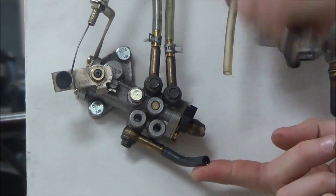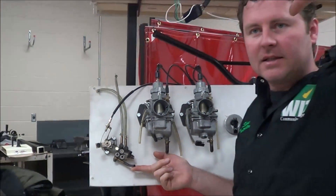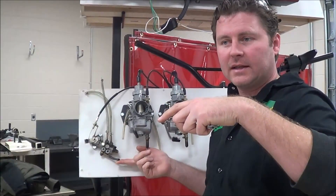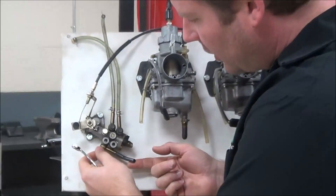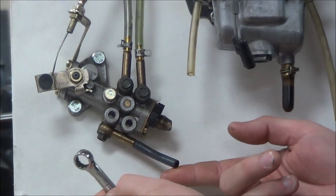Our oil tank is also going to be above the oil pump — this is back behind the rear fender on mopeds, or above the engine on a snowmobile. So this is always the lowest point in the system. What we could do here is crack this loose — I've got a couple of crush washers on here — and that will burp some oil out of there too, though it's going to make a little mess.